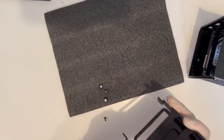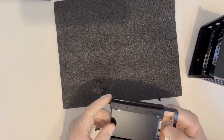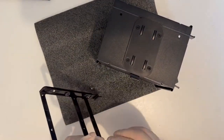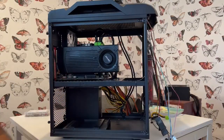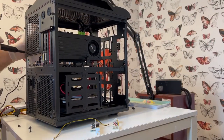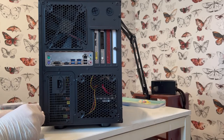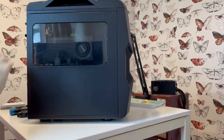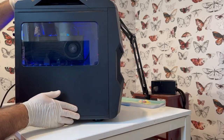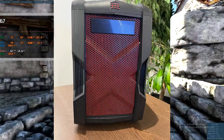Another bit I'm fussing about with now is the 256GB SATA SSD. It needs to go into its own adapter caddy and then into the slidable caddy from the case. I honestly really just like screws, because trying to plug a plastic adapter into another plastic piece can be a bit annoying, but in the end I got there and it's secured inside. All that's left to do is pull it all together. I won't kill myself with cable management in the bottom portion because nobody will see it since the window is only at the top. I did end up changing a couple of fans just to have something PWM on the motherboard and avoid any CPU fan errors at boot. Finally, let's turn it on and see how it's looking — not bad. I think it's a lot more impressive in low light, and for a PC on the inexpensive end of the spectrum, that looks very good indeed.